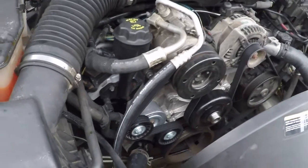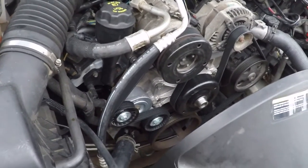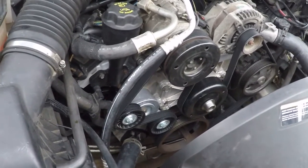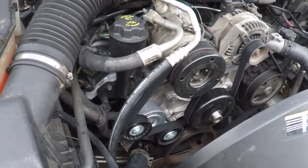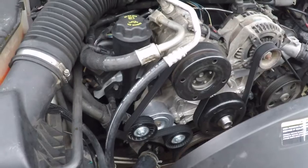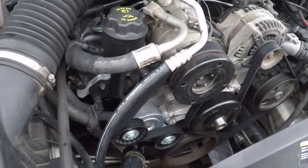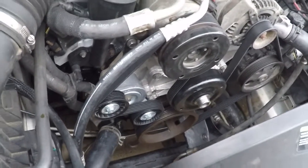Keep in mind, if you're having trouble accessing certain bolts, raise and lower this motor. Don't secure the engine mounts right off — get the engine pretty well mounted to the transmission, and then worry about that. Raising and lowering the motor will give you much better access to some of those bolts. You just have to play with it a little bit to figure out which is the best approach.